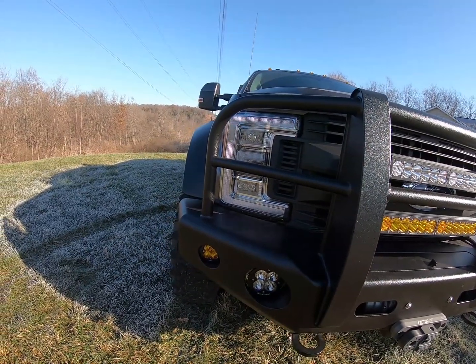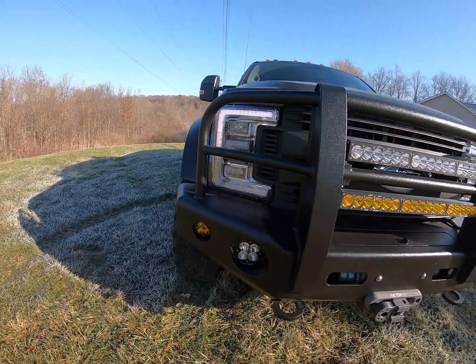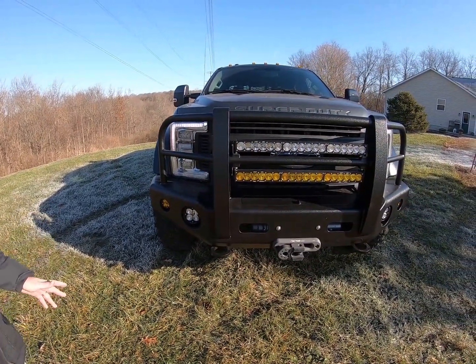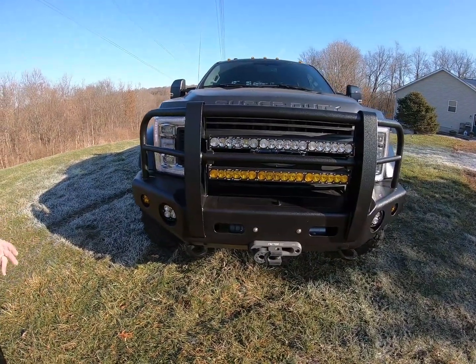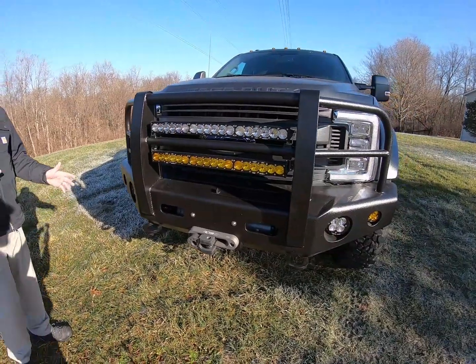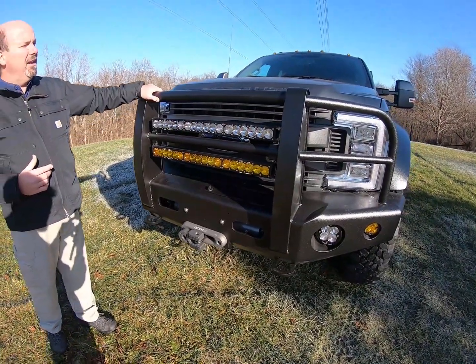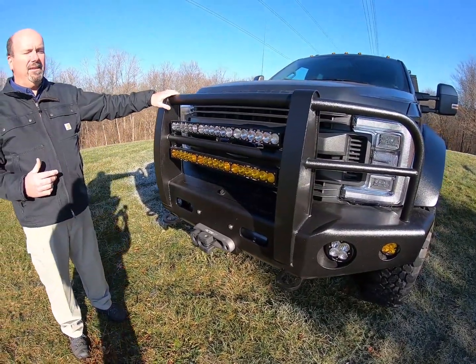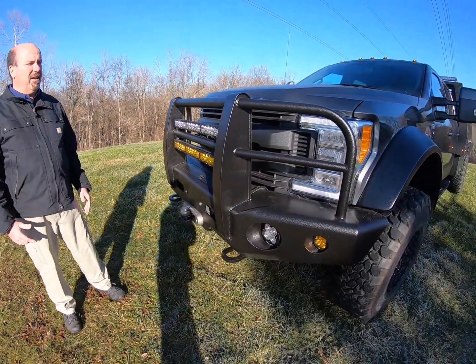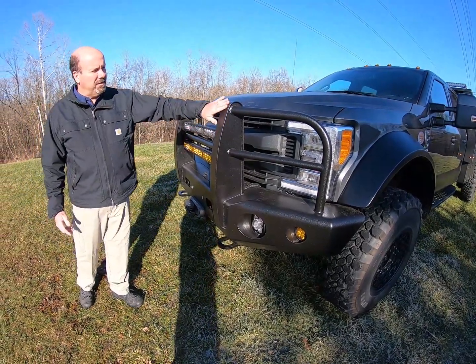When we were all said and done, this entire bumper got a full heavy coat of the IXS aliphatic resin coating — it's from their LineX Ultra line. It's an amazing coating: shiny, slick, and it doesn't fade or chalk like your typical truck bed linings. It's a little thinner coating but doesn't have near the rough texture.